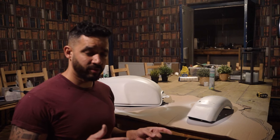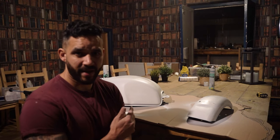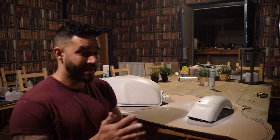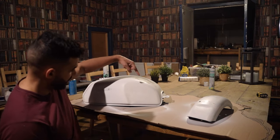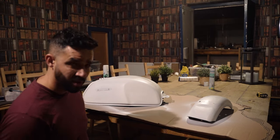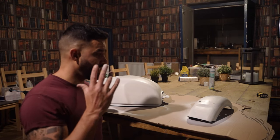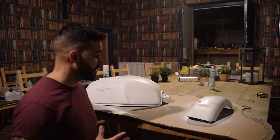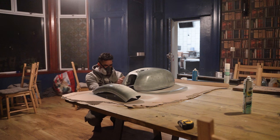The next day I ended up going to the car supplies shop and picked up some better body filler — the filler we'd put on just wasn't cutting it, it had too many imperfections. After that I ended up sanding back the body filler as well as that first layer of primer. What I've learned this time is not to rush it — I'll let each coat flash off for about 20 minutes before coming back and applying it gently. I'm really happy now; this was the area that was really badly damaged and it's now looking really good.